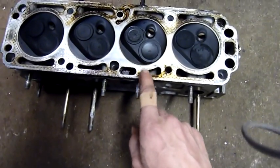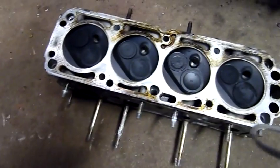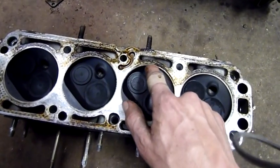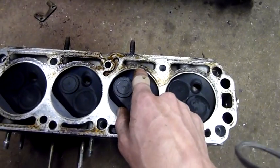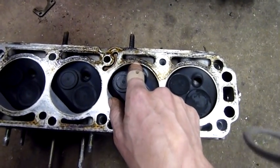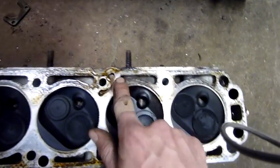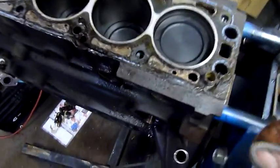It's actually marked on the head - I marked the compression readings on the camshaft support. Looking at it from this side, that was the weakest cylinder with 130 psi - the rest of them were 150 to 152. So yeah, there was an issue there - the system always pressurised the coolant even before it was warm, and that's a dead set giveaway that you've got exhaust gases getting into the cooling system. You can see it there - it's dark. The head gasket's blown.